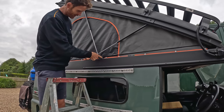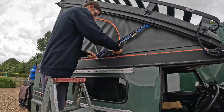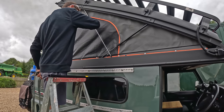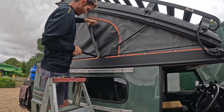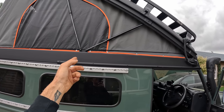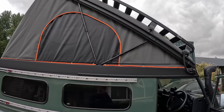That's the problem — look how long it needs to compress to go in there. Happy days, she's on! The big one isn't too bad, but the smaller one has to compress nearly all the way into the strut whereas the other one only compresses a little bit. For that one you might get away with just a strap, but if you're doing the one that compresses fully, I'd definitely recommend making that little tool.